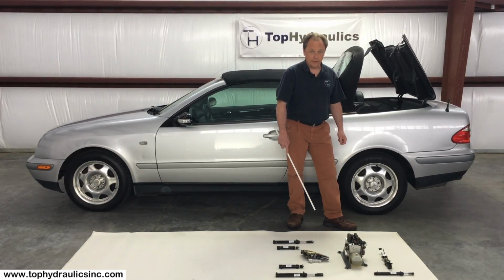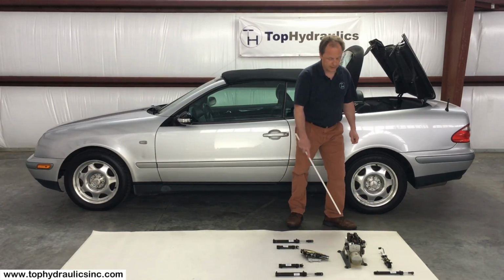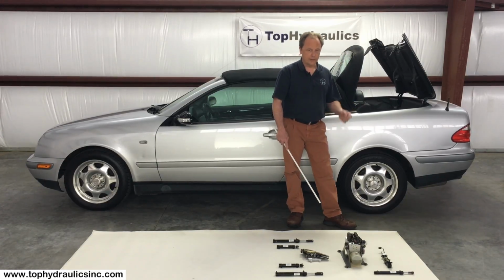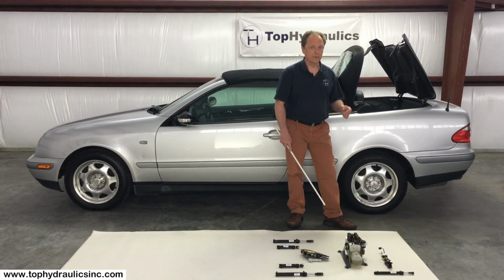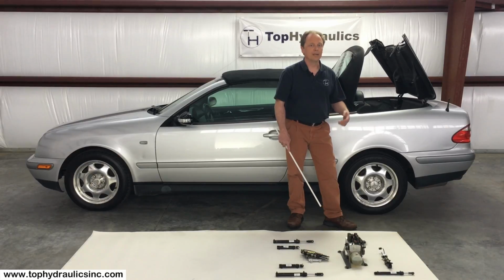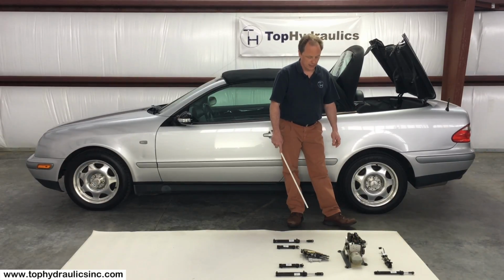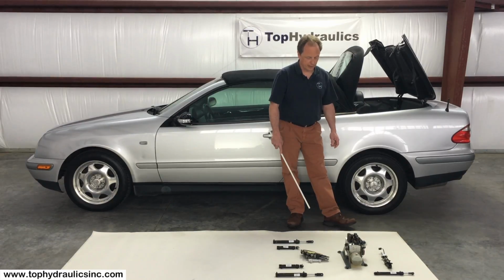We actually use 50% more copper than the OEM did in the pump by using thicker wire and more windings. Doing this, we have less current going through the pump for the same power, and the motor produces way less heat and should far outlast the car.